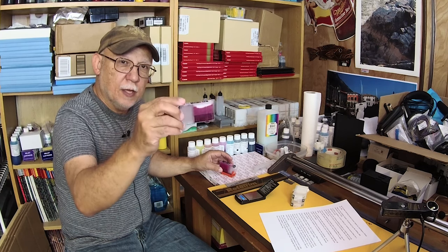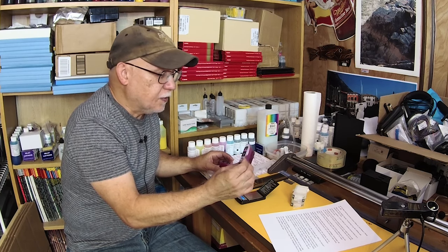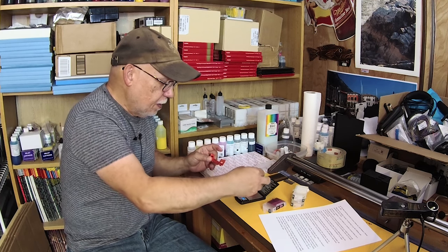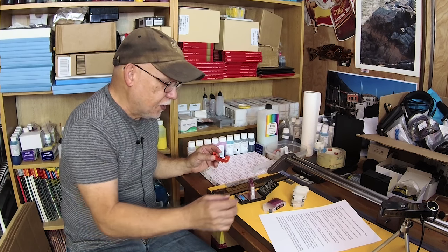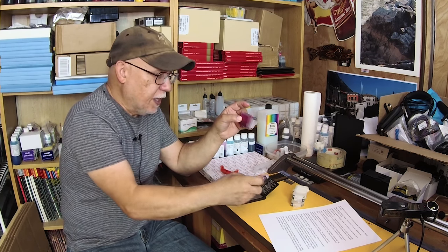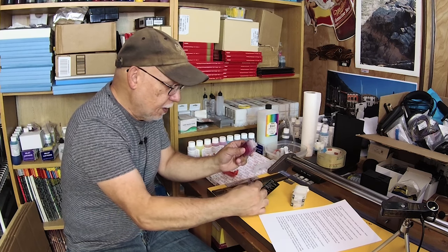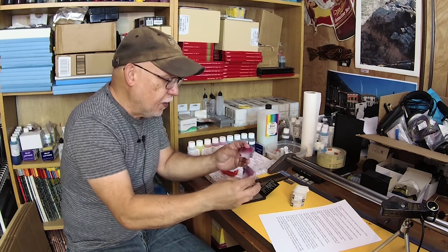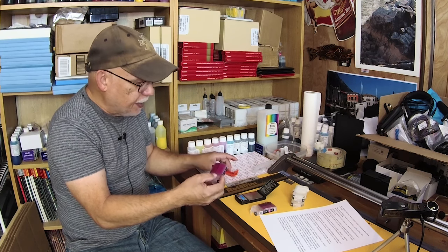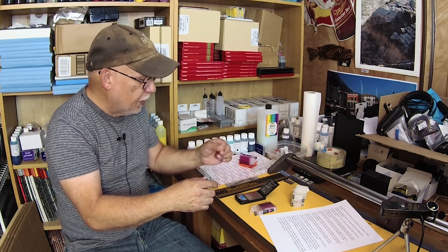This one is 13.98, almost 14 grams — it has a plug and a double plug. Here's a dried-up one: the person ran it dry and waited until the indicator said it was empty — 15.23 grams, still has the factory ball, has not been modified at all. And here is one that is also dried up, modified with a plug — this one is 16.68 grams. What this tells me is that this sponge is still a little bit wetter than the other one; it contains more ink. This one is 16.6 and this one is 15.25. As you can see I just got some ink on me, so it still has a little bit of wetness — this can probably very likely just be refilled right off the bat without any flushing.